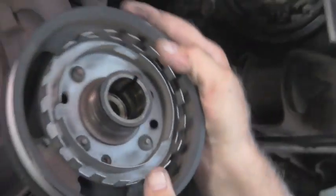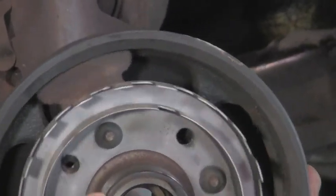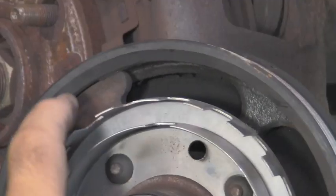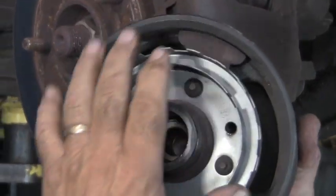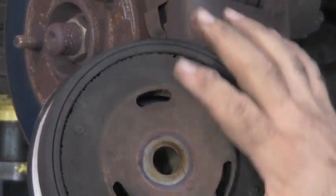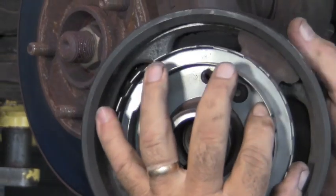Now what's making the noise? When we turn this over, you can see this counterbalance weight hitting the teeth in here. So we've got this counterbalance weight and that's what's happening. If this outer part were bonded to the inner part, then it would move like this. But since the rubber seal is broken, our counterbalance weight is doing that.